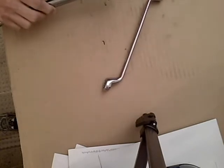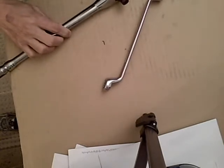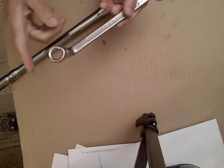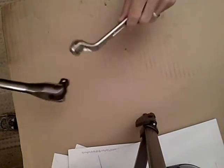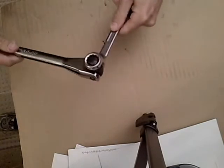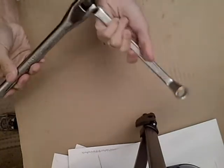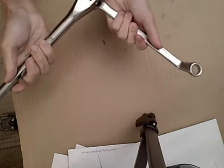I've got multiple options to use as tools for the serpentine belt removal. Optimally, you'd have either a serpentine belt tool or a very long wrench — I have neither. So what I'm going to use is this double offset box end wrench. One side is 14mm and the other is 15mm, it's 12-point. The 14mm end fits on the tensioner, while the 15mm end perfectly fits a half-inch drive breaker bar. The combination of the box end wrench and the breaker bar will give me the leverage to move the tensioner bolt.